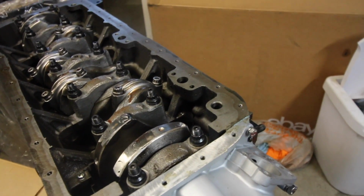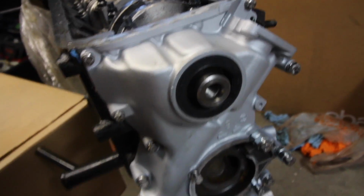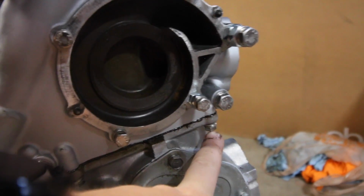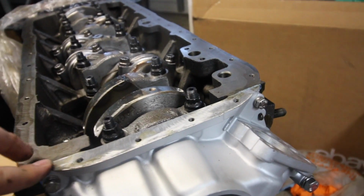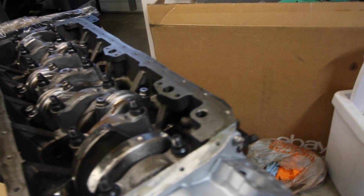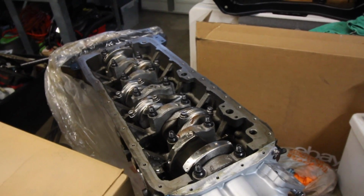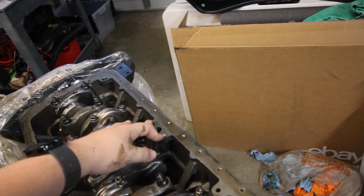One small tip that I read online, and I guess it actually worked out. So I got the cover on, and then I loosened up all the bolts here, and I got these 1, 2 right here on, and then tapped it up here. This way it pushes this down against the head and tighten these up first, and it got these two up here pretty level. So once I put the gasket sealer on the gasket itself, this should seal up pretty good. Hopefully no leaks.